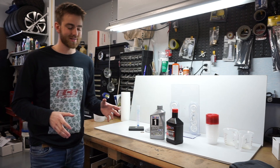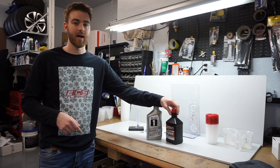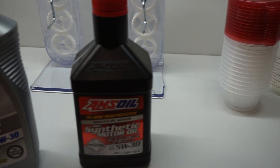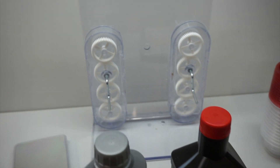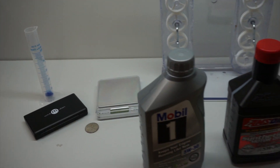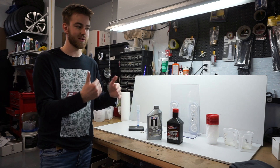There's going to be quite a lot of testing because I've got new at hot, room temperature, and cold for each test, and then used at hot, room temperature, and cold for each test, and then doubled for the Amsoil. So there are actually 12 different cups of oil total. I had to buy some Tupperware — new hot, room, and cold, then used hot, room, and cold, and then again for the Amsoil. I'll be going over specifics on this one, but from here on out the bench tests won't be as detailed. I want to do the bench tests and engine tests and get the information down on our Excel sheet so we can start to see oils side by side.